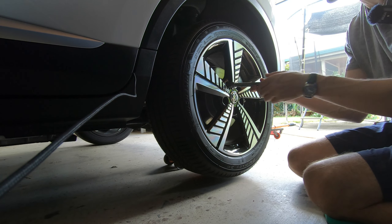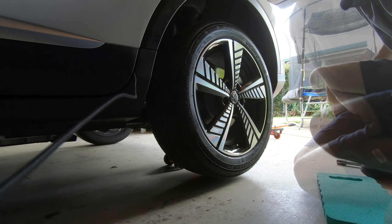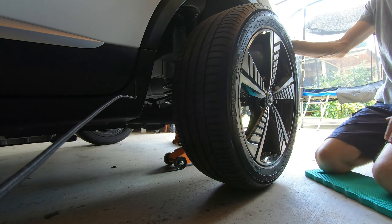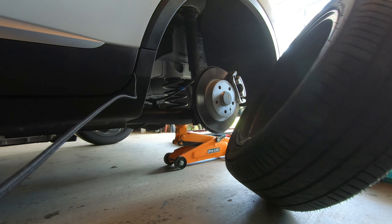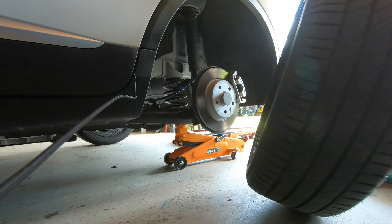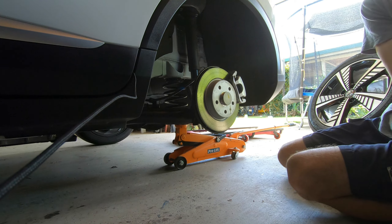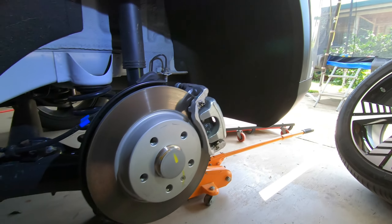Take the breaker bar off and get a shorter extension bar. What I generally do is leave one of the top wheel nuts in till last, so the wheel doesn't fall off. The other four are right out — there's your nice chunky stud. By leaving your top one in, the wheel sits nice and steady. Then get serious and take that last one off. These wheels weigh 21.6 kilos, so they're quite heavy — every bit of weight matters in an EV.